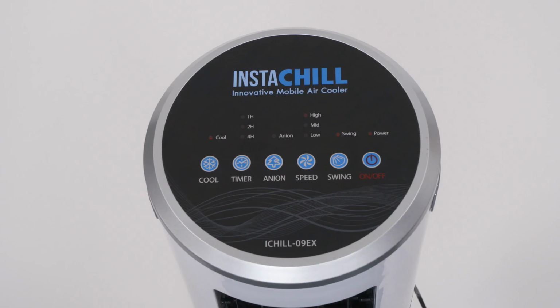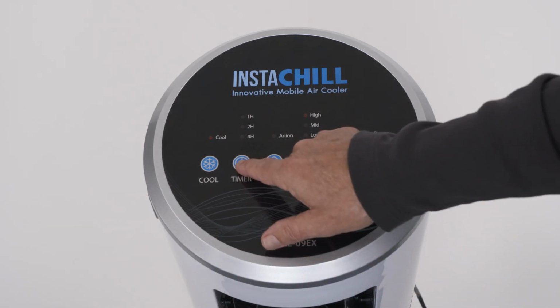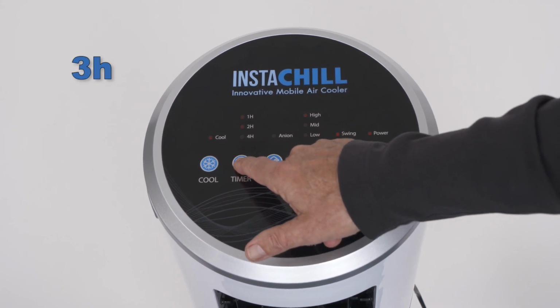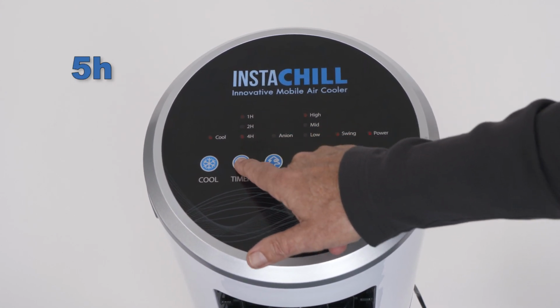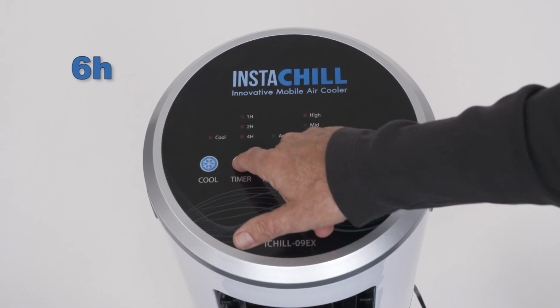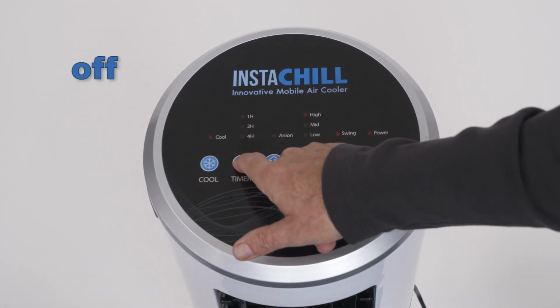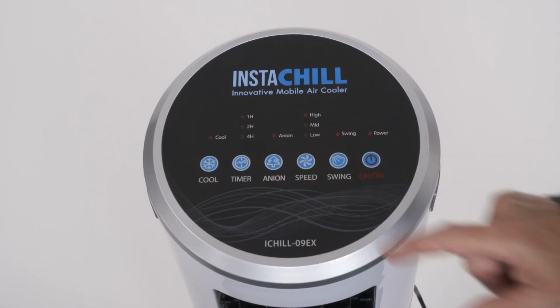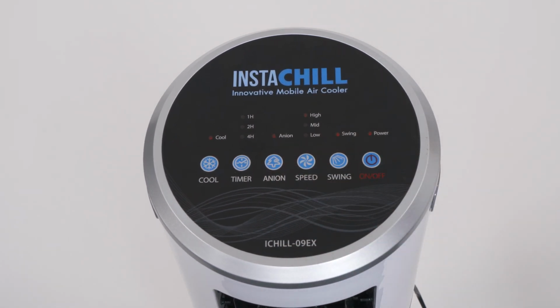The next function is the timer. Use this by pressing the timer button. Each press of the button will scroll through the options from 1 to 7 hours. And finally, there's the anion air cleaner. Use this by pressing the anion button. This generates negative ion charged molecules in the water which attach to dust and allergens and make them settle out of the air as it passes through the sponge.